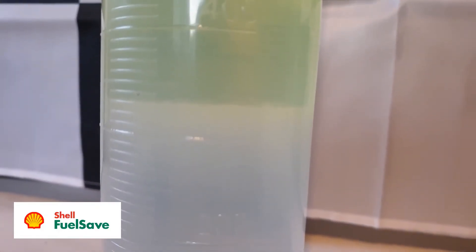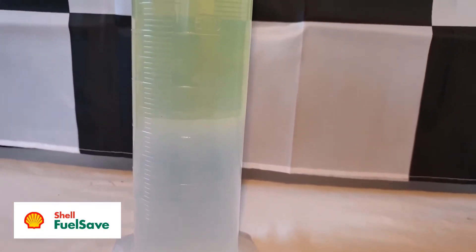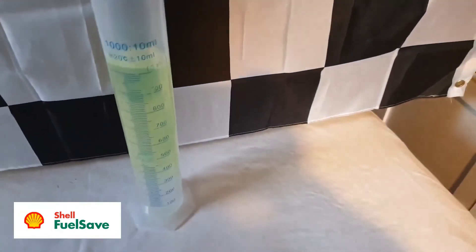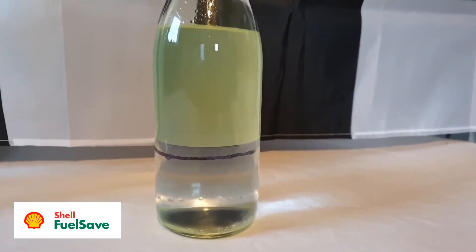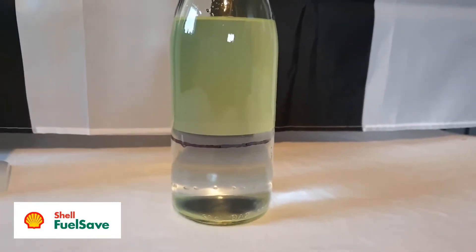On the back, it may not show on camera, but the line is around 330 millilitres, and the table isn't completely level, but it is adequate for detecting the difference between 5 and 10%. Something else which may not come over on camera is this frothy separation line that we didn't get on the ethanol-free petrols. These tubes are semi-opaque, so let's take another look at the glass bottle to see if there's any more clarity to the petrol, and I'll mix it again to see if the froth will be more apparent through the clear glass.